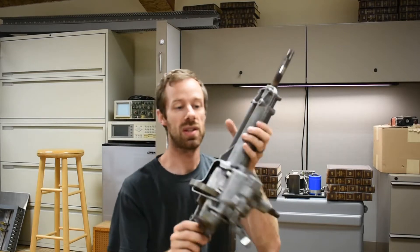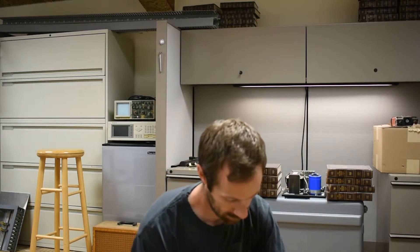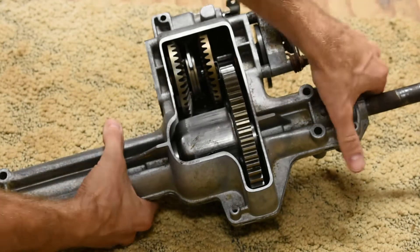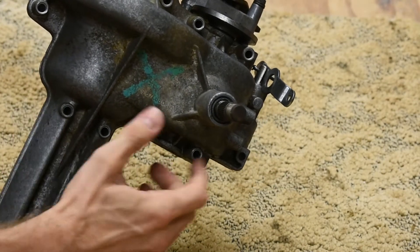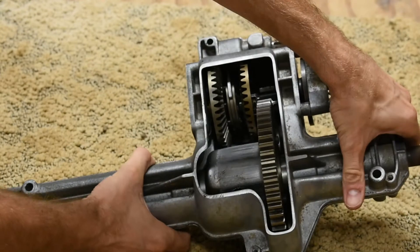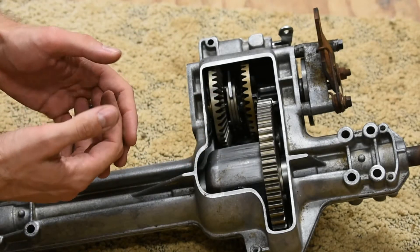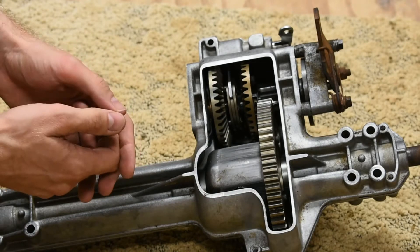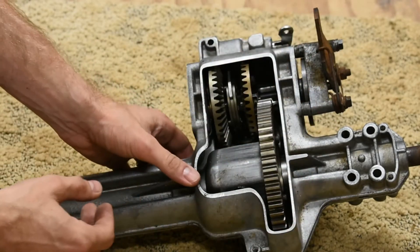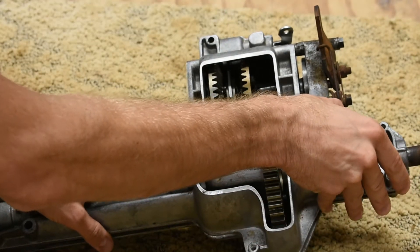Here's a little view of what that looks like when it's completely assembled. Let me go ahead and disassemble it and check out what those gears look like inside. This is the bottom of the transmission. If we flip it over, the top has this piece sticking out — this is a splined shaft and that's attached to a pulley that comes directly from the output of the engine. This transmission does not have gears in the sense of shifting from first gear, second gear, third gear. It's simply driven straight off of the engine, and to go faster we just make the engine RPM go up, or slower go down. It does have a forward and reverse. The bottom has been milled off on my dad's milling machine — we went over to his house a couple of days ago and set this up. Really fun project.